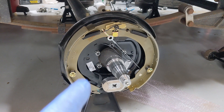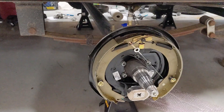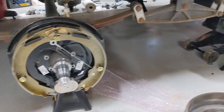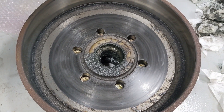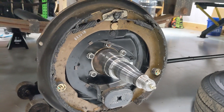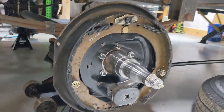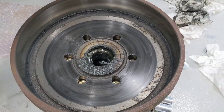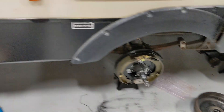I put an automatic adjusting brake in on this first one and the drum is getting turned tomorrow. I was really on the fence — do I check them all or not? Well, I did them all anyway because I'm Captain Overkill. And look at that — the seal is blown out on that one. It's absolutely smooth and wet in there. Those brake pads were probably barely working because you've got grease on the front of the pads. That's not going to be a very effective brake.